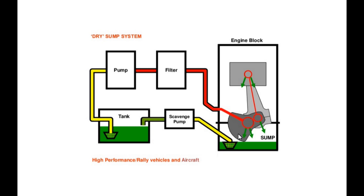The clearances are extremely tight — not just in terms of the crank itself but in how much oil actually sits down there. On my Maserati, at best we see about a half quart of oil ever in that pan, so no matter how much it sloshes it really isn't enough to cause a problem or rob horsepower. The other advantage is you don't have an oil pan hanging down, which allows the entire engine to sit lower in the vehicle. Lower and unsprung weight are key things in a performance car.